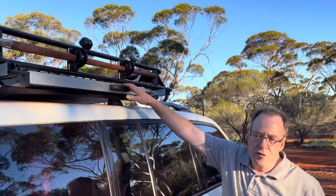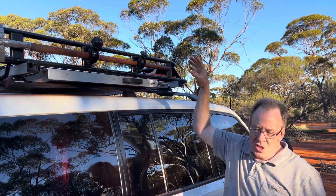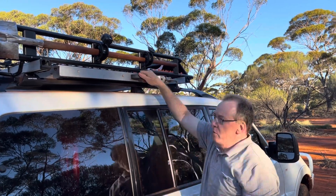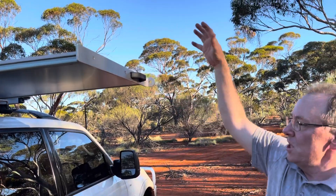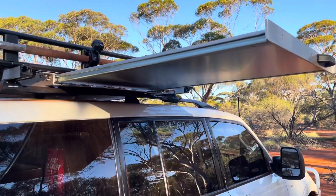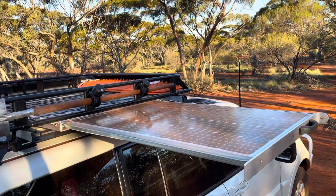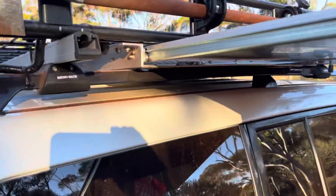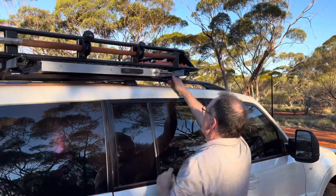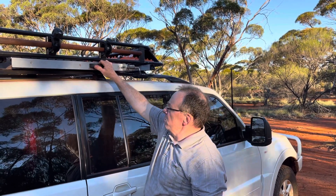Here's the solar panel — it's sitting under the roof rack. If you have tents or swags up there, you'd prevent the sun reaching the panel. So what you can do is slide the panel out when you stop for lunch — the sun continues to hit the panel while you're stationary and keeps your battery topped up. I've made best use of the space under the roof rack — there's only 50mm clearance between the rack and the bars, but that space was otherwise wasted. It's a very secure spring-loaded latching system, can't come out, and the panel doesn't rattle.